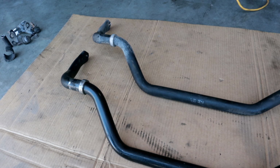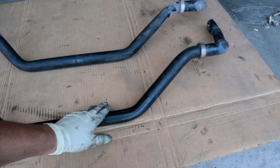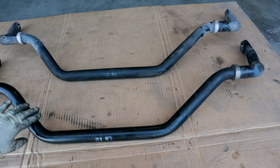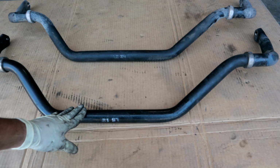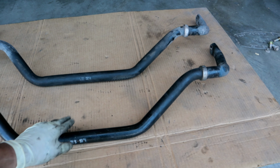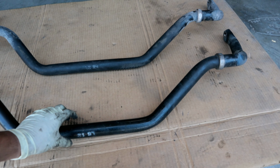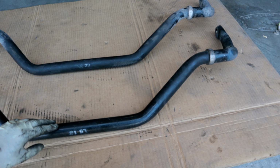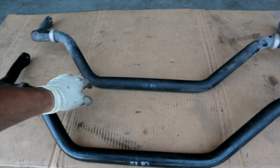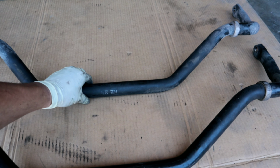Now I know what you guys are probably wondering, what huge of a difference will it make if this is actually heavier, and it actually does make a huge difference. This sway bar is supposedly 17% stiffer compared to this sway bar, and that is because it's thicker inside. So the wall that's inside of the tube here is thicker compared to this. So let's go ahead and weigh these to see what the difference is in weight, so that we can get a somewhat accurate reading.